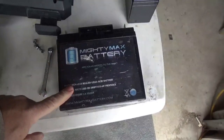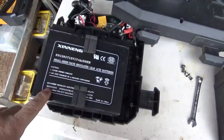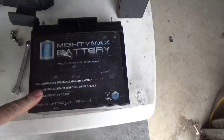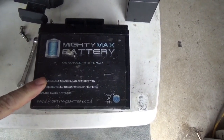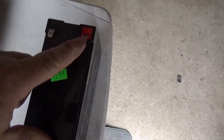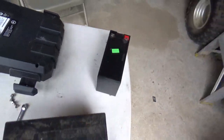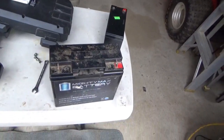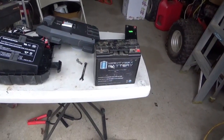I think I'm going to go with a change of plans. As I was looking to put the battery in, it's going to be loose in the case and rattle around quite a lot. I bought this Mighty Max battery a while ago and it seems to hold charge really well — I was using it on the garden tractors. What I liked about it is the high amp hours and the lug-style terminals. These tab-style terminals you can drill and modify to turn them into lug style. And 9 amp hours will work on an all-terrain vehicle — typically 8 to 10 is what they require.